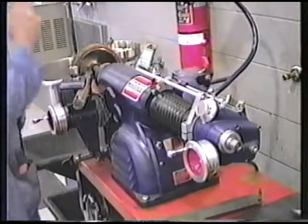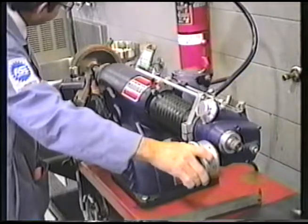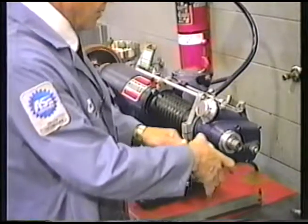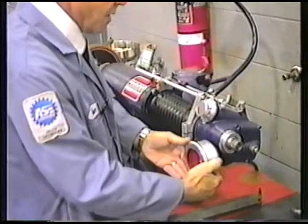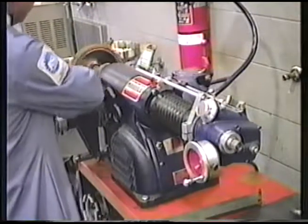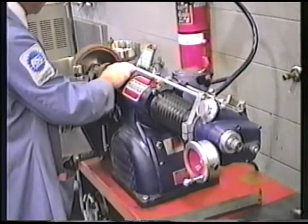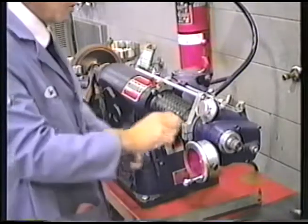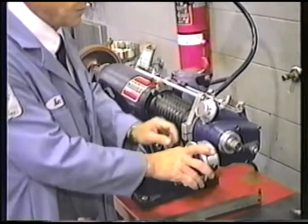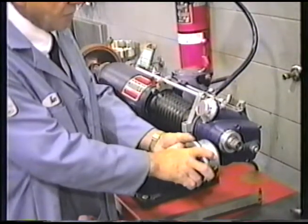We'll turn the lathe on. We will advance the drum to the cutter. It just touches, like so. We'll loosen our little black knob here. Rotate our graduated dial up to zero. Move the boring bar all the way to the end so it takes care of the entire surface of the brake drum. Okay. Then we will advance the necessary depth, which in this case I feel as though 5 thousandths would do it. So that would be like 2.5 marks here. 2 thousandths, 4 thousandths, and halfway in between would be 5.